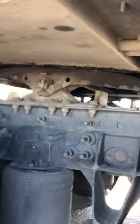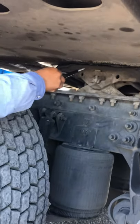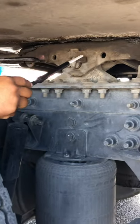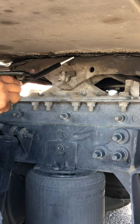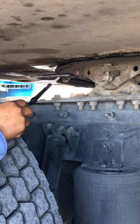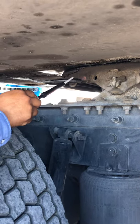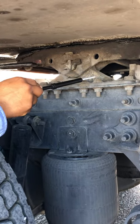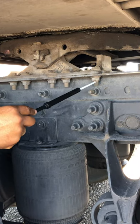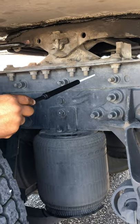This is my fifth wheel. I'm gonna check my apron — properly mounted and secure, not broken or cracked or illegal welds. This is my skid plate — properly mounted and secure, not broken or cracked. This is my pin and cotter pin in place, holding the skid plate together with the platform. Make sure there's no gap between the skid plate and the apron, and it's properly lubricated. The release handle should be in the lock position all the way in. The platform is properly mounted and secure. Check the mounting bolts — all present with no rust or shiny threads indicating looseness — properly connected to the frame.